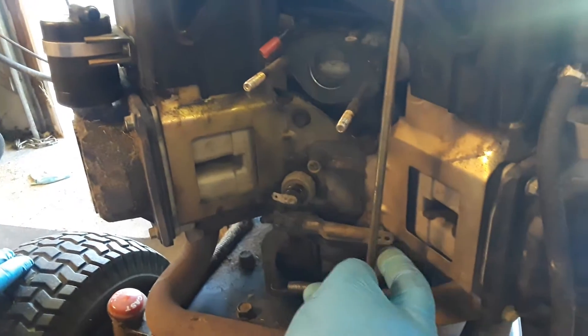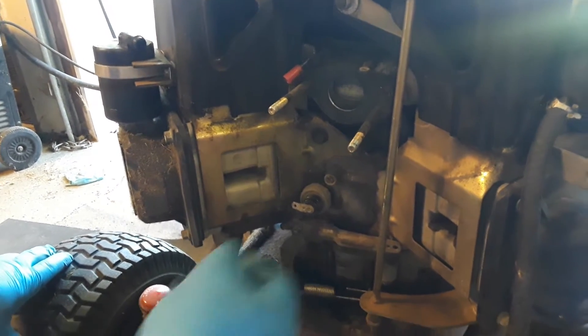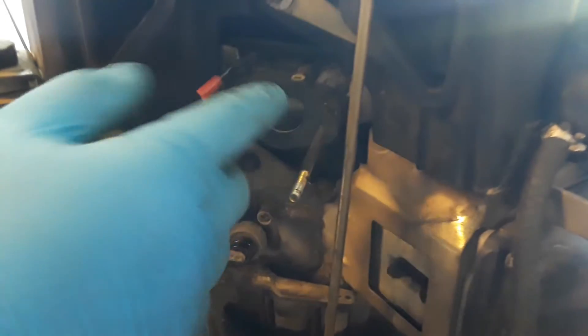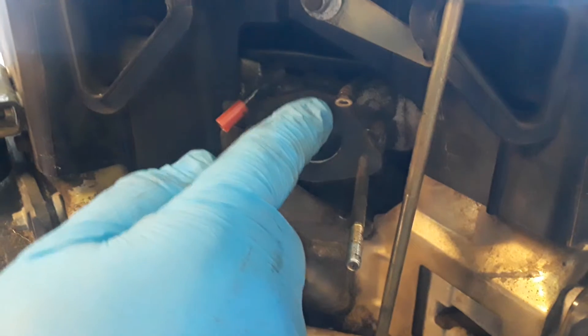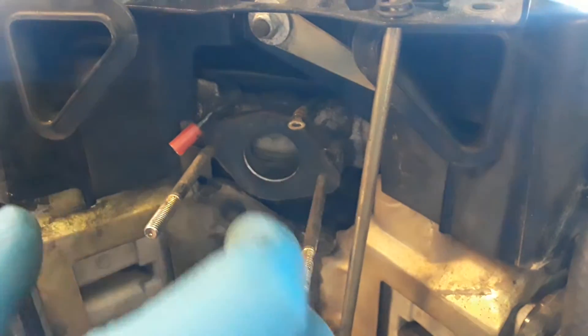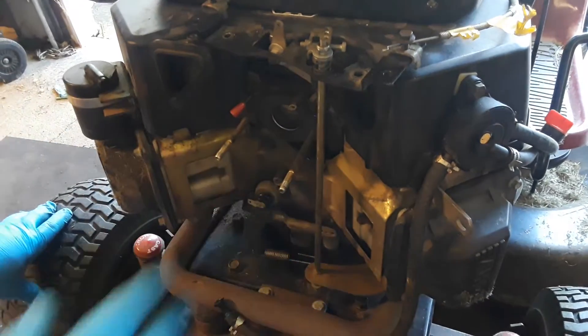Both linkages with these plastic clips came off. The fuel line — newer — that came off too. There is a negative right here, and that's a little tricky. I had to get that off as well because I almost forgot it — I was trying to pull it out and couldn't see. When you disengage this, the thing moves around. Be very careful not to throw that off because you don't want to have to mess and readjust that governor. It's not fun.